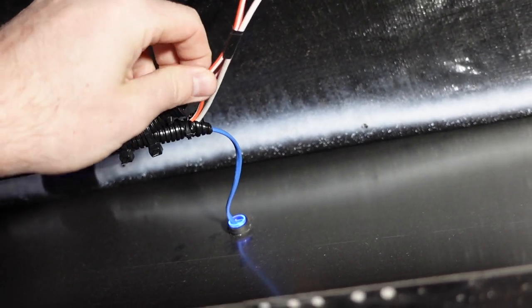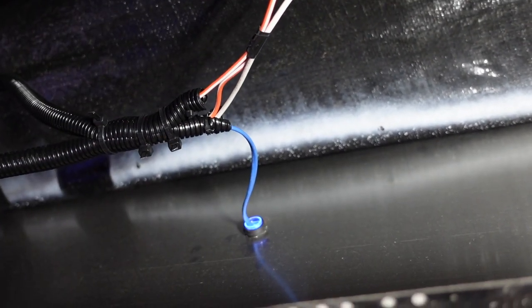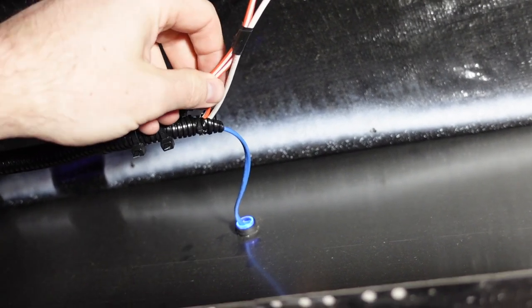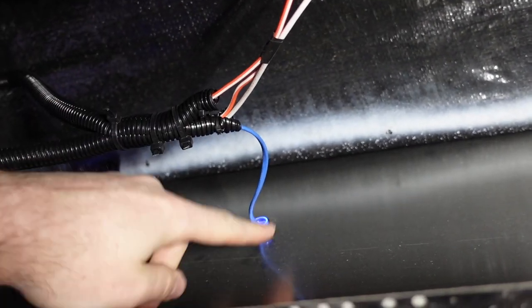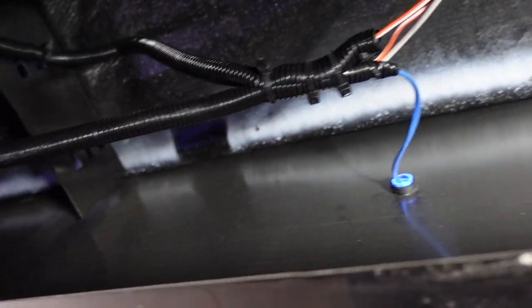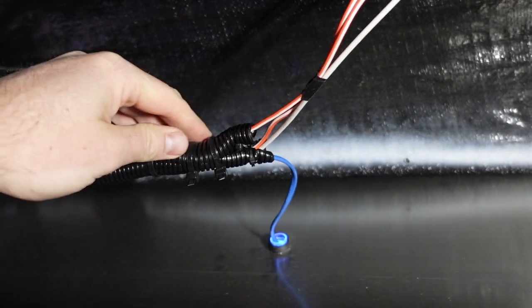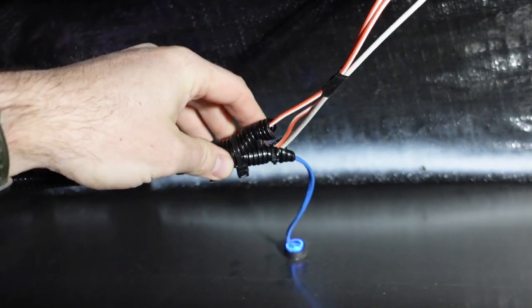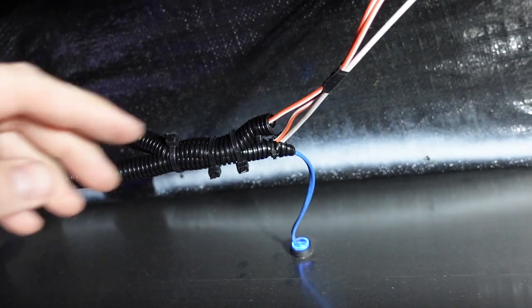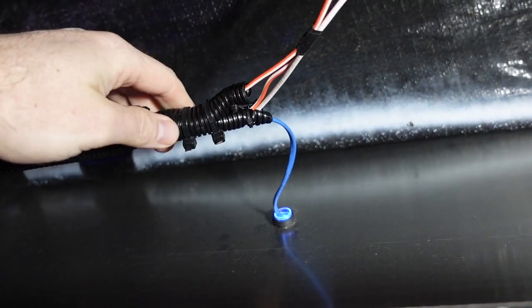As for what kind of wire to use, I'll put a link in the description to one I really like — it's a 16-gauge 12-volt style wire. What I like about it is it's double insulated, with regular insulation plus an outer jacket that keeps the two wires protected, almost like Romex in your house. I just took the 12-volt step light connection and added a new wire feeding down to the blue LED strip. I prefer to solder connections, especially where you want it waterproof. I soldered the red together with the orange-stripe wire and the ground, then used heat shrink tubing over that to make it waterproof.